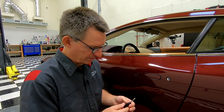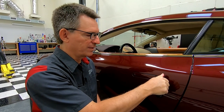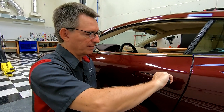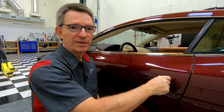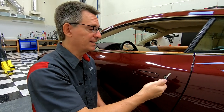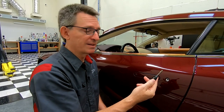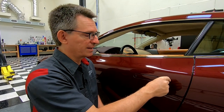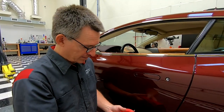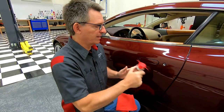To do this, we're going to start by trying it out with the key to see what the lock feels like beforehand. It may feel a little grunchy if you haven't actually used your key in a long time. My car is 16 years old now and I've probably used the key twice. Give it a try to see what it's like at first. Then let's get our lock lube and give the can a good shake.